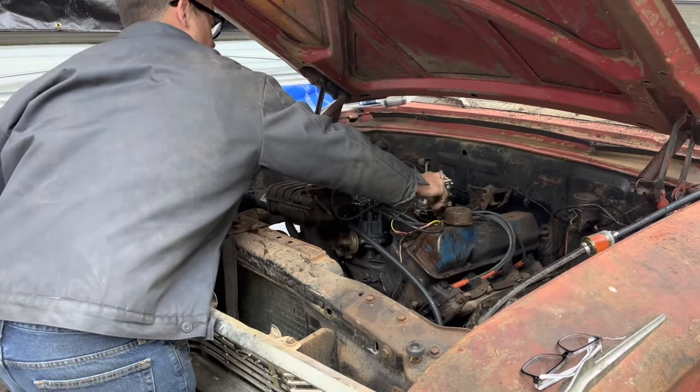But the other side, I thought I was gonna have to make a line for the other side, and I may still have to. But then I noticed it twisted just a little bit, and then it stopped twisting, and actually the nut spun free. So I'm gonna chance it on that one. But I'm not gonna hook these hoses up yet to the lines, because I wanna flush any trash out of the metal line before we hook that up, or you're just putting it straight into your wheel cylinder and it might hang it up or something. Isn't that right, Rocky? You can't let the trash go through your wheel cylinders, right? Don't eat the PB Blaster. Come on. Time to move on to the master cylinder.